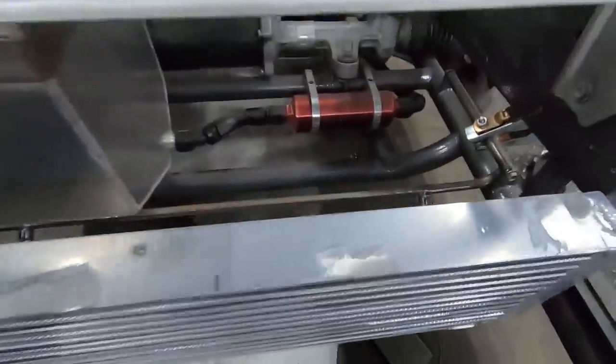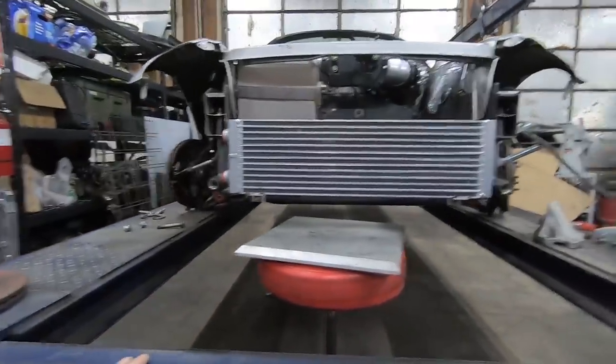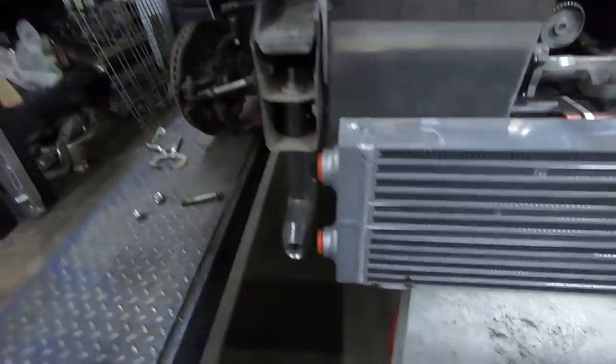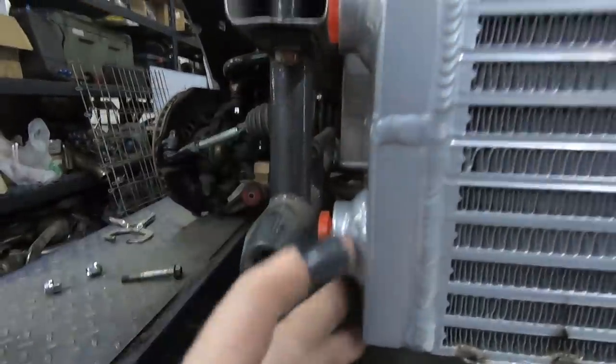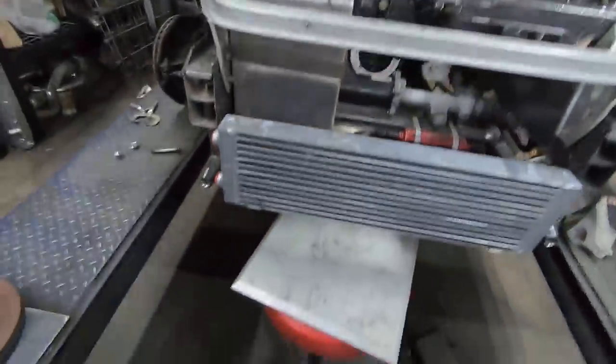With just a couple tacks it is now on the car. From here I can keep designing the way the rest of it is going to go. I still need to change some of the plumbing on this side - I'll be cutting off these fittings, putting some inch-and-a-half pipe on here up to our dash-16s. The plumbing for the top will go through that channel, and then this one I'll be getting a dash-16 welded on there. That one will wrap around back through here and up through this little hole because the pump is on the other side of the frame rail right here.